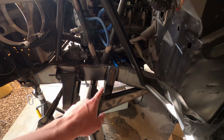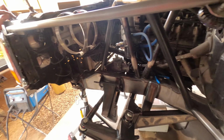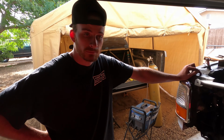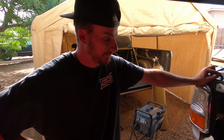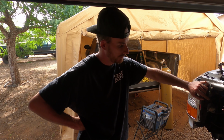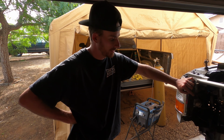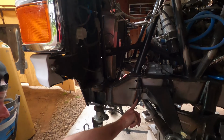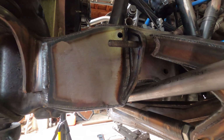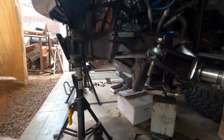And then Christian also got the beam mounts burned in, and also got the beam to radius arm mounts burned in. You ended up making the tabs for the swingers as well. Yep. And that was all done by hand, right? Hand and computer. Okay, so you kind of used some mock-up stuff and then drew it in the computer from there? Yeah, I drew the rough shape of the main part of the tab on template paper, and then took that into the computer, and then I also did an overlay on it that has a little bit of a cutout in it too. So you got to put overlays on everything, huh? Well, it's got to all match. You got to keep everything consistent.